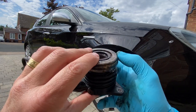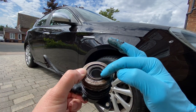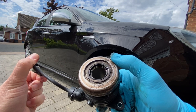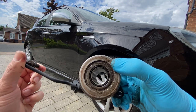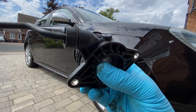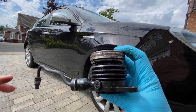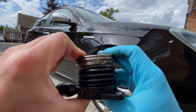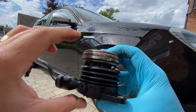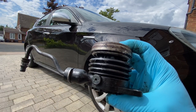Hopefully you can hear that gas release. What's actually happening is around here — you can actually see where the seal was bubbling up in the last bit. The fluid was coming out, so it's the seal in that part that's actually failed. Basically, when I was putting my foot on the pedal it was staying down — it just wasn't holding it down or pushing it back up. That's the part that failed.